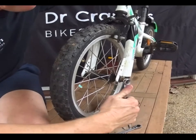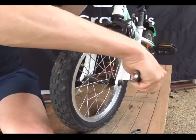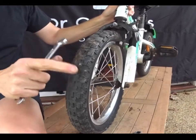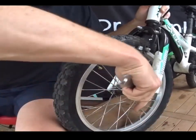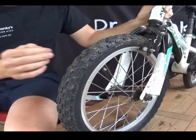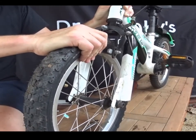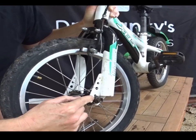Then we do these nuts on both sides. Check it — we're set. As we show with the loose nuts, you can see they're holding the wheel in — the wheel can't fall out. If the wheel falls out when you're riding and drifts away, you're going down and over the handlebars. So it's very important to have those safety washers and the tab into that point.